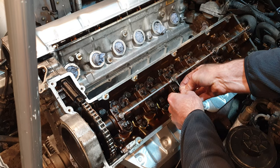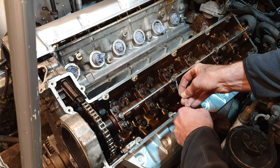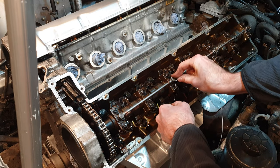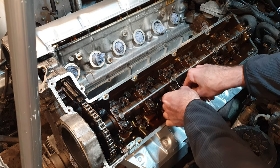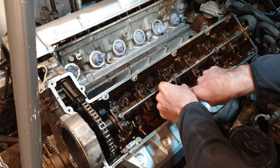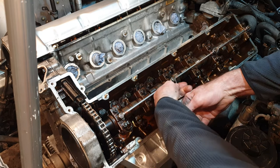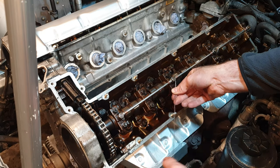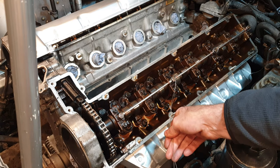Now you want to pull this tight and then start twisting the wires together to lock this position in place, like so. To speed up the process, you can get special pliers that make this winding process easier, but all you essentially need is a pair of vice grips, which I appear to have mislaid.